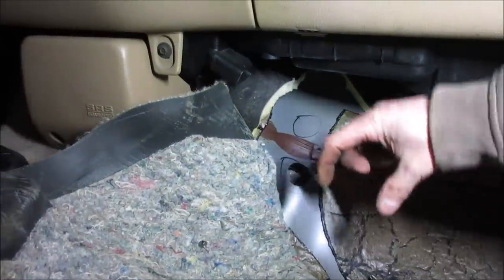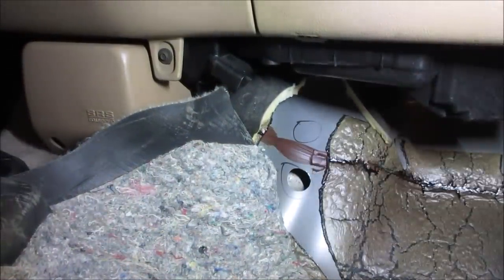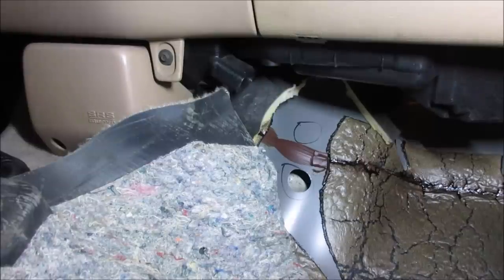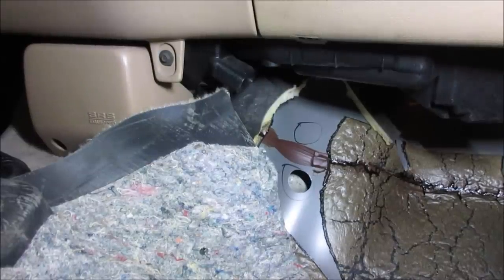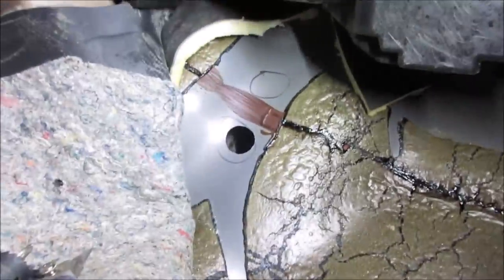Here's the reason why I'm kind of chasing it like this. Because I know those two bolts are really going to be rusted in there. They're steel going into aluminum. And by the rust that was on that bracket, just how the coil kind of came apart, it's going to be a bear. It's not like we can just reach in with a socket and get them out real easy. We're going to have to fight with them. So, get the heat shield out of the way.